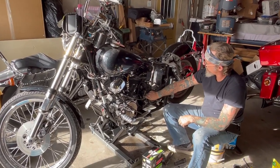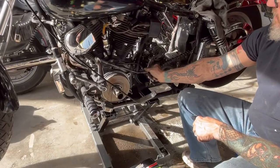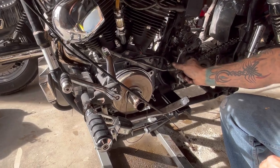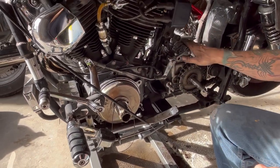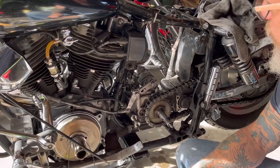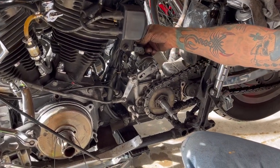Got this all back together, all the linkage cleaned up. I do need to grease that zerk fitting, and I'm going to take some of that slop out — adjust this arm out just a little tighter. You can see it's all cleaned up. Went ahead and replaced the springs inside the top and had the plate welded on, which is your drum plate, your shifter gear plate.